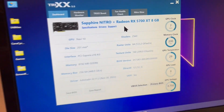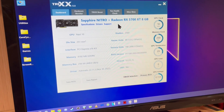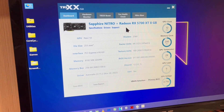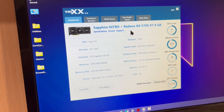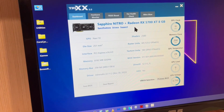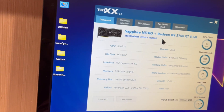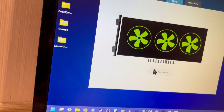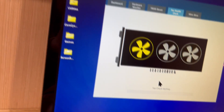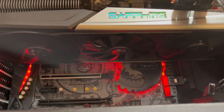Everything is fully functional. I've been testing this for a few weeks — the temperature seemed okay, but the VRM and the memory seemed to run a little warm compared to temperatures I found online and in Gamers Nexus' review. How I discovered the fan issue is I went to the fan check tab right there, and then you just come down here and click Start Fan Check. It's going to start on the left fan — as you can see, it's going to spin up these fans.